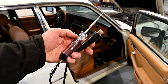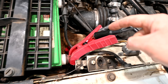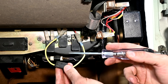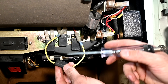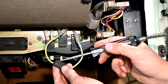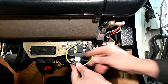To check for a short to ground, you use a test light. Connect your test light to the power side of your battery — we have a dead battery here, so I'm connecting it to our jumper box — then come to where the fuse is, remove the fuse, and check for ground. You should not have ground at either of the fuse pins. Power comes through one pin, through the fuse, and out the other. So test one — nothing — the other — nothing. We don't have a short right now, which means this fuse is probably good.